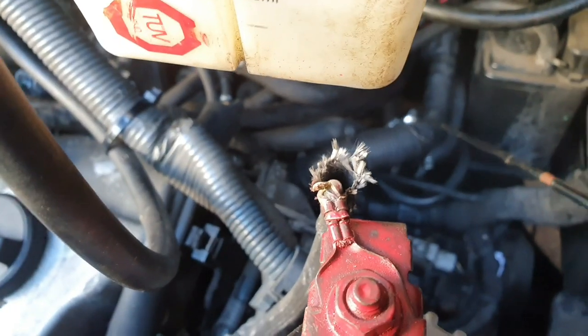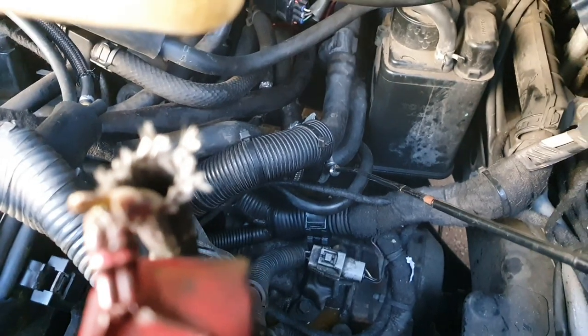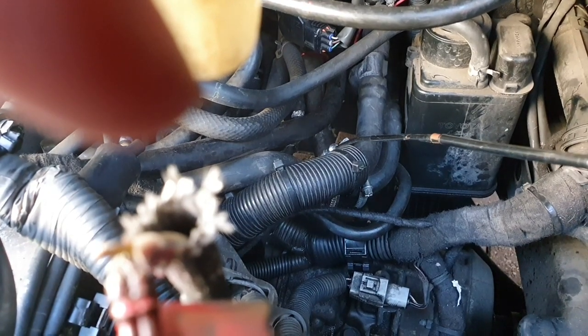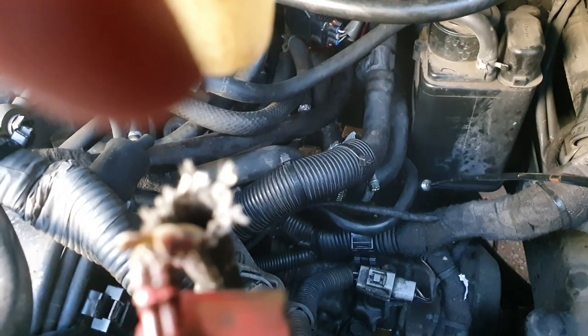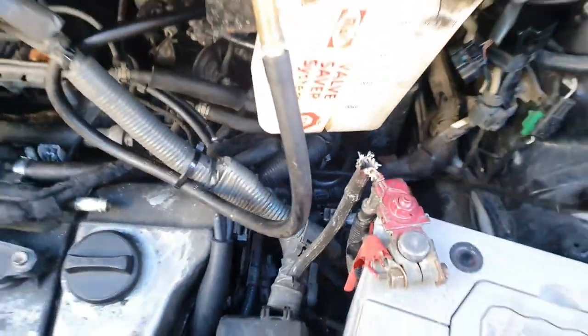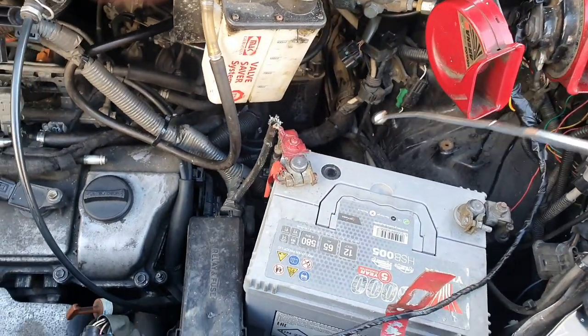The leak is coming from down here, falling onto the gearbox assembly and pooling there. You get that acrid smell of coolant burning — the gearbox housing is going to be fairly hot at about 95 degrees Celsius. The original thought was that it had to be one of the Jubilee clamps that had slacked off, and sure enough there was a slacked-off Jubilee clamp in the area, which gave me that idea.